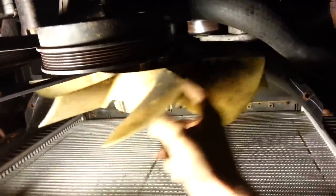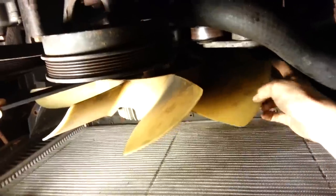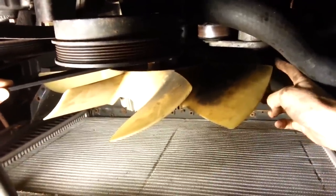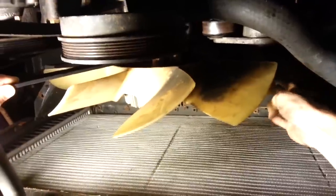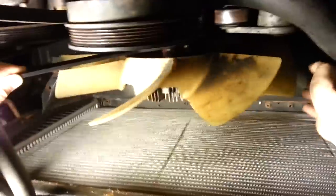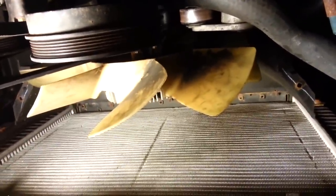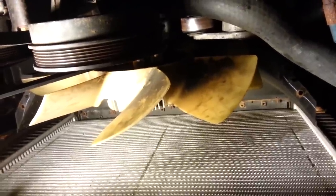Just for comparison's sake, I'm going to do a before and after. This is the old clutch — you can see how easy it turns. If you get a hold of yours and you can spin it that easy, then your clutch is shot. Under a good clutch, normally if you spin it really hard, it may only go from like 3 o'clock to 6 o'clock position and then stop. But if your fan blade turns this freely on a 70-degree day, then you know it's shot.